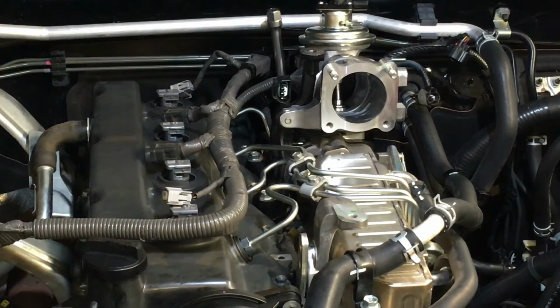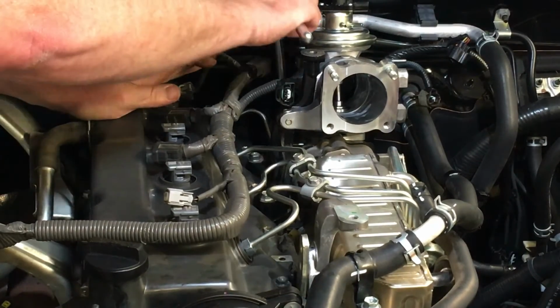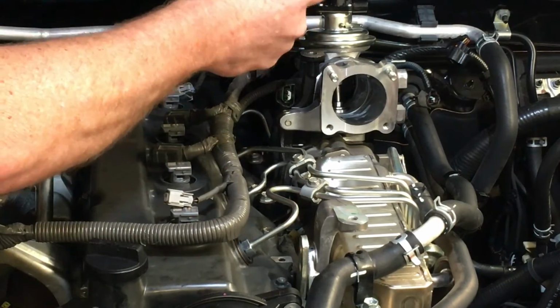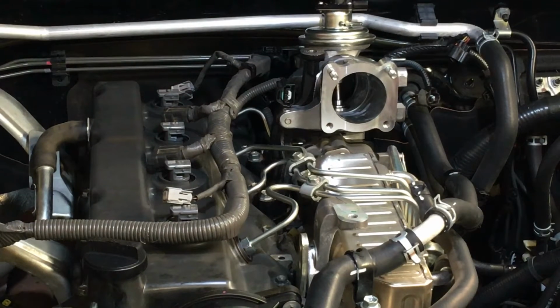That's good. So for tightening down purposes, I would say tighten your three. Your three go down into the manifold first. So we'll do that. I think they're probably again about a 20 or 25 Newton meter thing. I really have no idea. Look, I've looked it up. Looked them up years ago. A couple of times. Just going to get the longer extension. It feels like it works better. Could be making a mistake, but anyway.